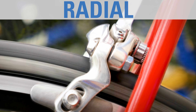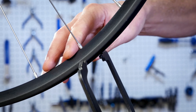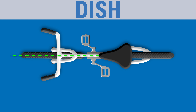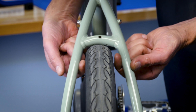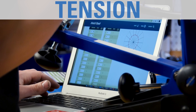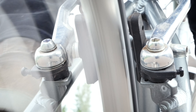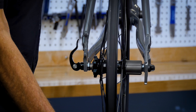The wheel's roundness — its amount of up and down movement as it spins — is its radial trueness. Radial truing is adjusting spoke tensions to correct issues of roundness. Again, if the metal of the wheel was bent by impact, the results may be limited. The two wheels of the bike should be aligned to one another as well as to the center plane of the bike. We can see this wheel is off-center in the frame. The dish, or centering of the wheel, can be corrected by adjustments to spoke tension. Much like any other fasteners, spokes have a range of acceptable tightness or tension. Wheels with extremely varied spoke tension will not stay true for very long, and wheels with spokes that are too tight or too loose can cause problems.